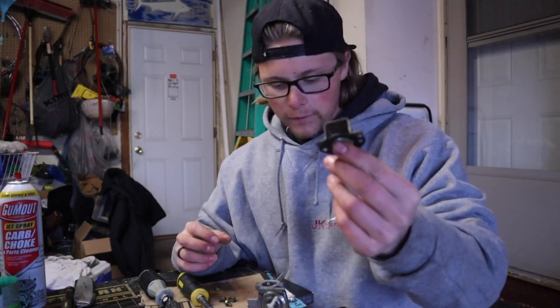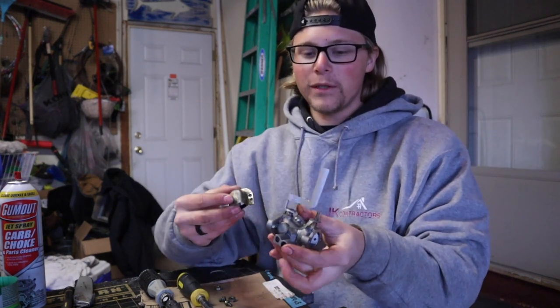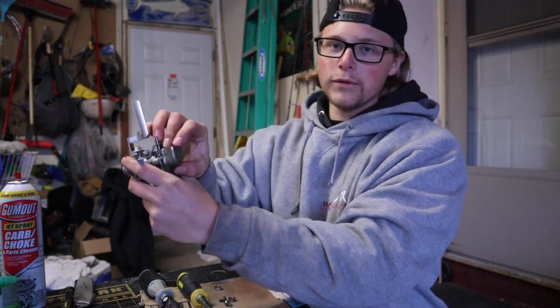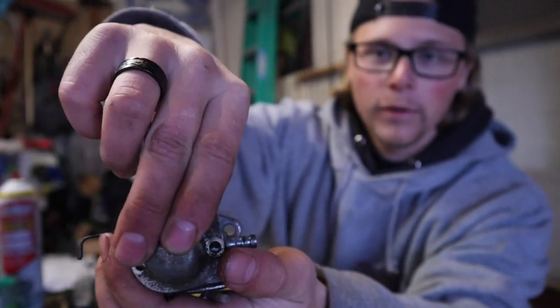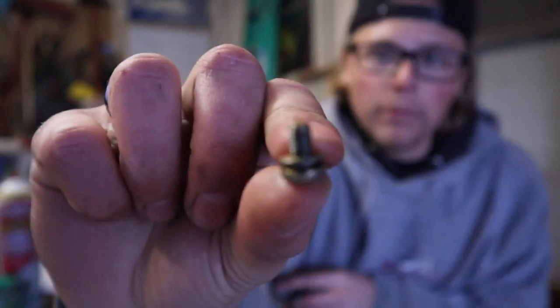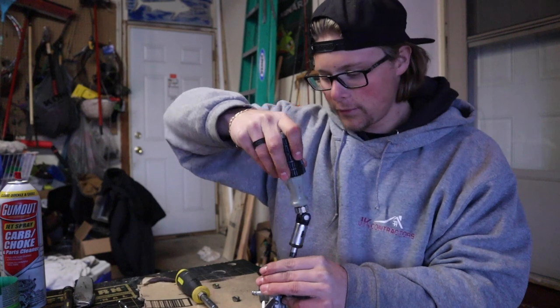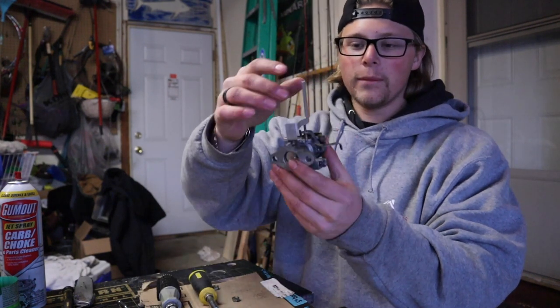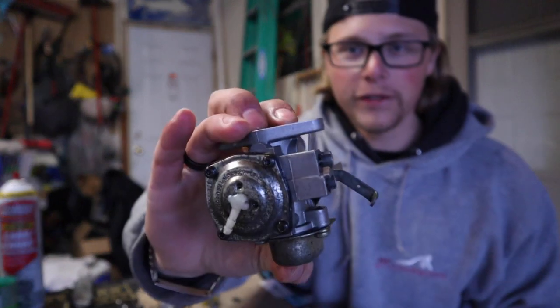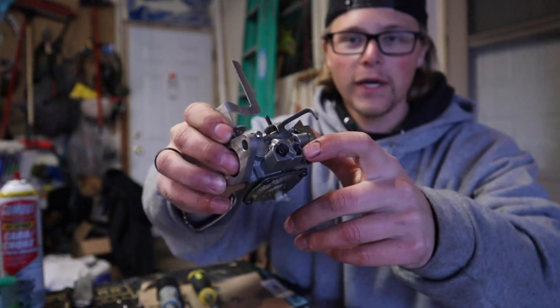Before we do our adjustments, we're going to put this end piece back on — this is the air intake end so it doesn't suck water. Your float bowl is always going to be at the bottom, so we're going to have this facing upwards. That's the float on the bottom — we're putting this facing upwards so it's sucking air from above. These are two really small screws, again with the star bit. Put these in and snug them up — torquing these isn't that important, it's just a little cover. Here's our reassembled carburetor. Looks a lot prettier than before with everything scrubbed up. The needles are still in and I'm not going to adjust them until it's back on the engine. Next step is to put it back on.